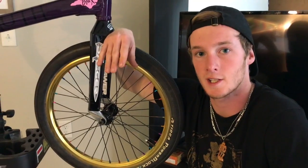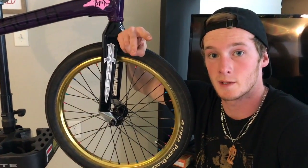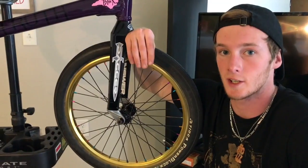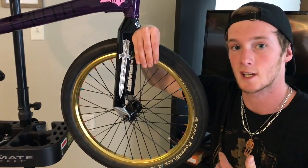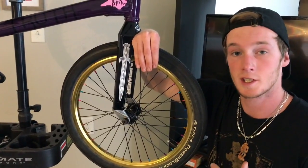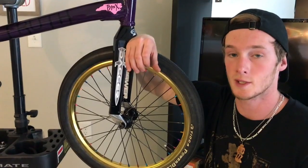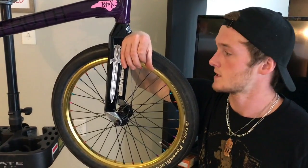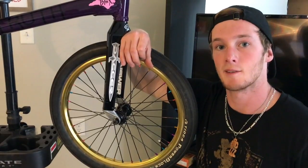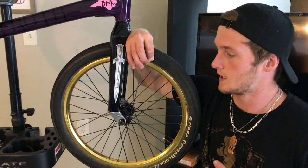So the couple considerations you're going to want for tire pressure are traction and rolling resistance. Down the first straight, you're going to want a lot of traction, because you're coming out of the gate strong. You put a lot of pressure on and you don't want to spin your back wheel. Also in the first turn, or any turn really, you're going to want to be able to carve it without losing that traction and sliding out. If your tire is too inflated, you're going to slide out. So that's why I'm going to suggest that average of like 50, or like I said, 10 below the recommended.